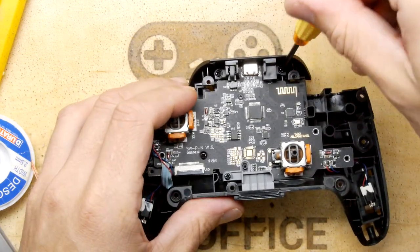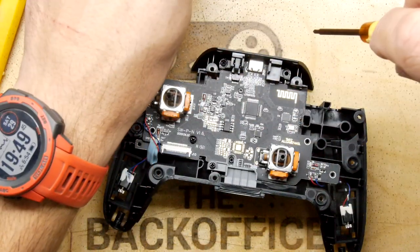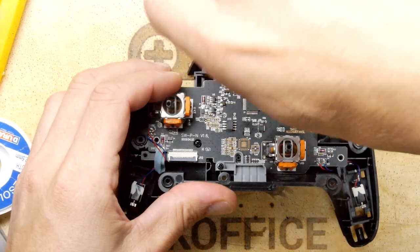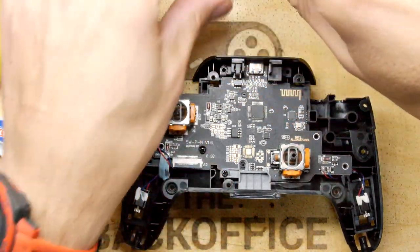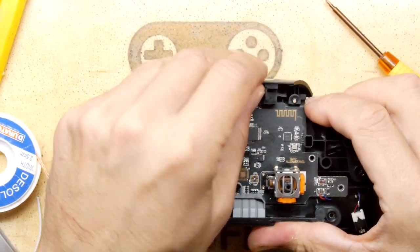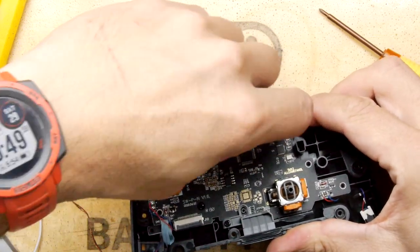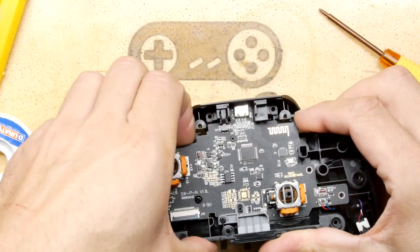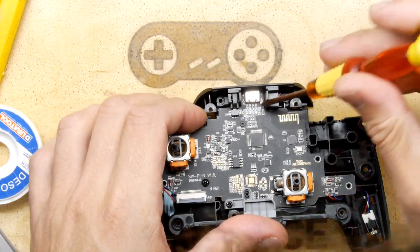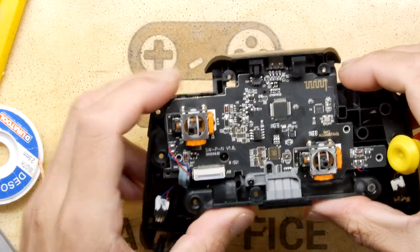I think I'm going to have to remove this back panel because the USB-C is poking out through there. I was speaking to Electron Ash while I was having my FTDI woes, and he shared with me some really interesting insights on USB-C. I think now I'm going to be removing USB mini or micro from my projects in lieu of using a USB-C, because they're much simpler to wire up than I previously appreciated.